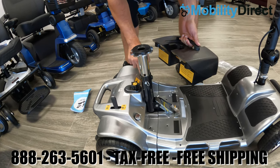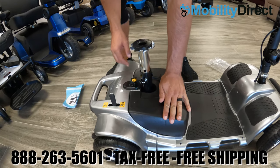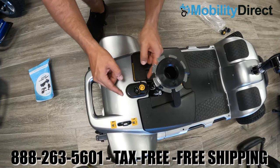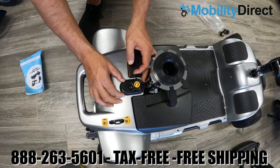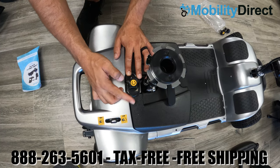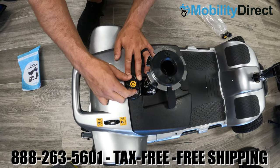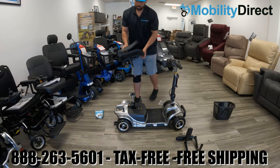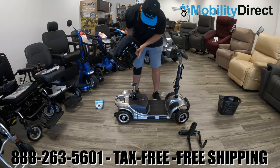There are two metal terminal connection studs that touch up against the terminal connections located on the bottom side of the battery box. Towards the rear, there's also a little tension plate that you have to rotate so that the left and right side of that plate are on top of the battery box — that's going to push down the battery box so that the terminal connections can meet with the proper tension.